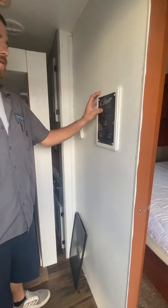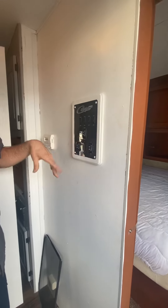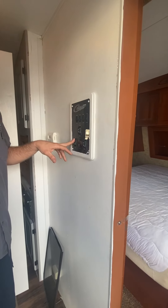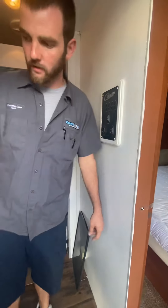Alright, so you've got your ceiling lights, porch light, step light — all that — your awning switch, and then your slide-out switches. When you're bringing it in, as soon as you hear the clicking stop, that way you don't strip out the gear.